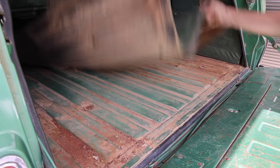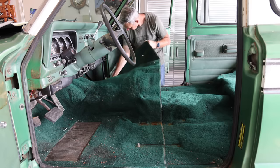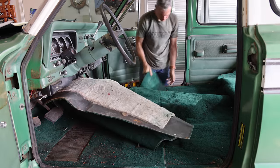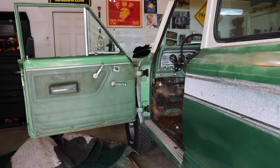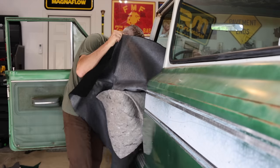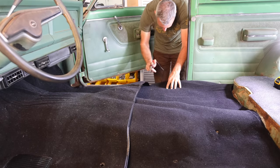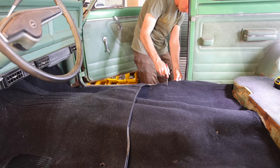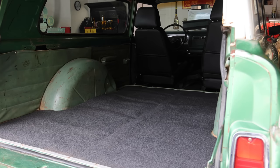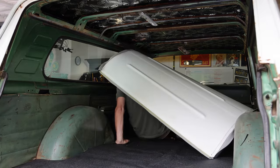While the paint was drying, I started removing the old vinyl from the rear and the carpet. The vinyl was the original — in bad shape — but I think the carpet has been replaced recently, though it's a different shade of green than everything else inside the Jeep. There was a lot of cleanup involved. The carpet is pre-molded and only required a little bit of trimming, and the hardest part is making the holes for the new seats and seat belt. I found that using a soldering iron to burn the holes for where the seat bolts go through works pretty well. I installed a new piece of fitted vinyl to the rear and added some sound deadening underneath that, along with some sound deadening on the roof. Hopefully this will help with heat in the summer and make things a little quieter when I'm cruising down the trail.